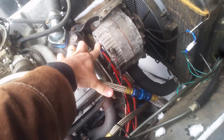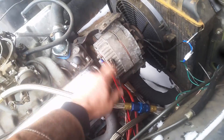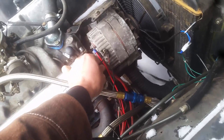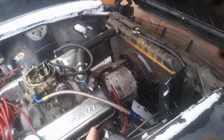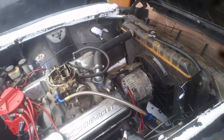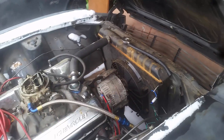The bolt centers are the same, it's just a matter of bolting up. To reiterate: this wire goes to the hot to charge the actual battery; this one jumps back and goes to the non-switched portion of my fuse box; and then this one goes to the switched portion, but can also be interrupted by an idiot light. Whenever the alternator stops charging and this terminal is no longer at 12 volts, the 12 volts supplied through the ignition switch will give a ground to the idiot light and it'll light up.